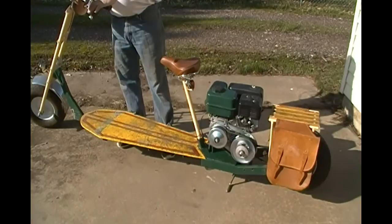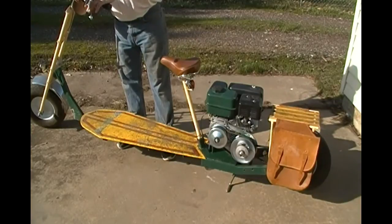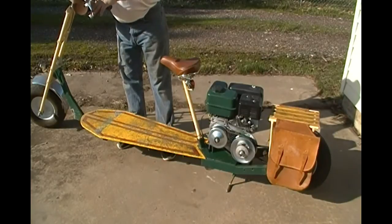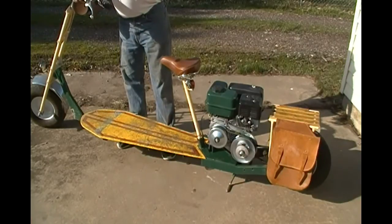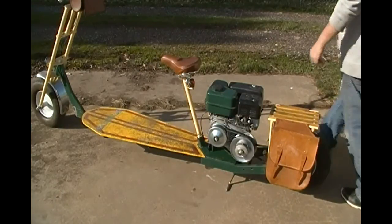Didn't want to stop. I was hoping that that would actually idle without that rear tire spinning. That's always been a problem with that centrifugal clutch too. It seemed to run through. Didn't have no brake to stop it. So I'm gonna take all the slop out of that cable and readjust them. Okay, I got that brake adjusted a little bit. Try again.